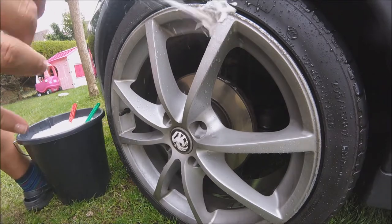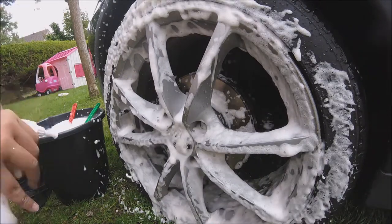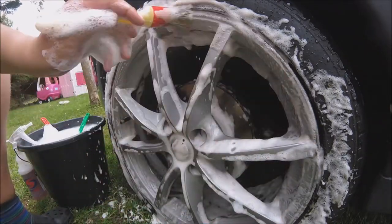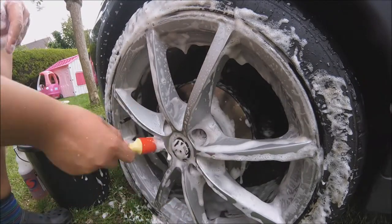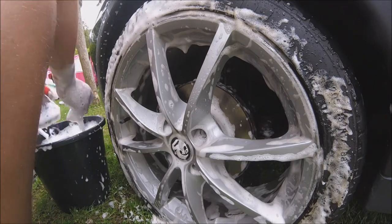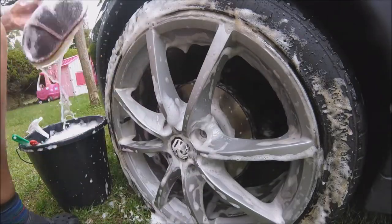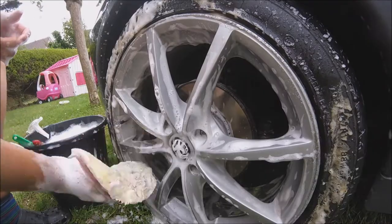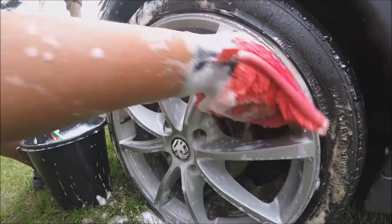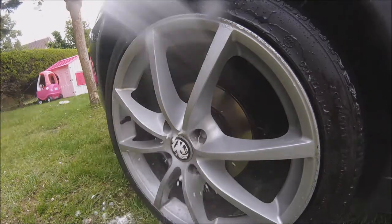We are cleaning the wheels with Smart Wheels, which is a heavy duty acid-free wheel cleaner with a high-foam, high-clean formulation and excellent deep cleaning performance. It removes stubborn brake dust and grime. I used 100ml of Smart Wheels and the rest water, as the wheels did not need a strong mix. I recommend using Smart Wheels with a foam trigger spray head, which you can get from eBay for pennies, as it helps the wheel cleaner cling to the wheels and dwell for longer. I'll link the foam trigger heads in the description as they are well worth using with Autosmart Smart Wheels. Now that the wheels are cleaned, let's move on to the next stage.